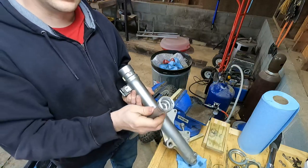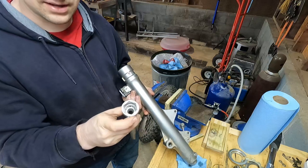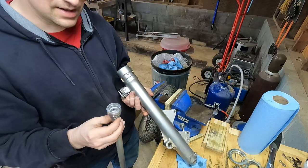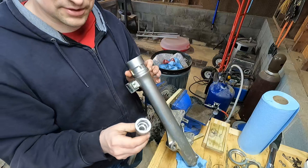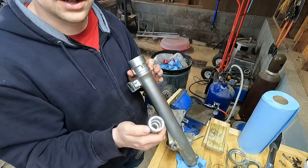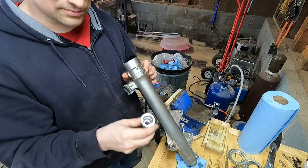This is a KDX200, and the top of the damper rod is a hex key shape — this is a 27 millimeter cross. I've read that some of these are 30 millimeter; I don't know what years of KDX would be 30. This is a 2006 and it's 27 millimeter. So I went to Tractor Supply and got a bolt — a metric bolt with a 27 millimeter head, and I believe it was an 18 millimeter thread — but it doesn't really matter because I'm going to cut all that off.